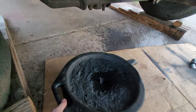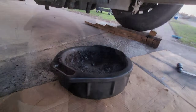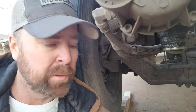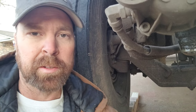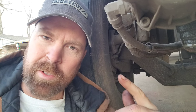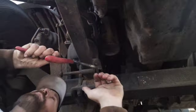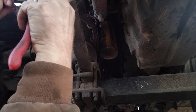One of these oil drain pans works really well for draining the oil from the oil filter - just stick it underneath the axle. There's the filter. Before I do this, I usually loosen up that oil filter just a little bit - not to where it's leaking oil, just loosen it a little. Then you can poke the holes in the bottom of that filter, let it drain out, and then twist it off without having to deal with all that oil.